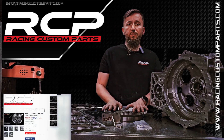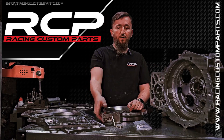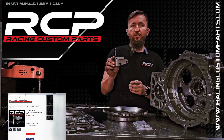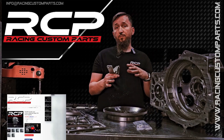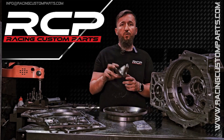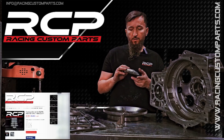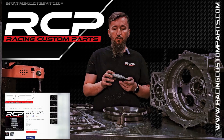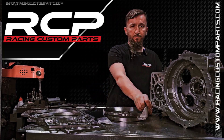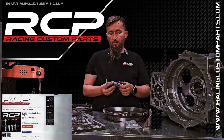That's why we developed the stage 3 and stage 4 flywheels, so they can be used in motorsports. With the DQ500 and MQ500 gearbox adapter set for the R32 engine, it's worth getting a mount for the transfer case. If you don't have our reinforcement or don't want to order it, you can order such an adapter from us as well — it will hold the transfer case on the R32 engine. And since the transmission is disassembled anyway and you're probably reprogramming it, we also have aluminum mechatronic sleeves with O-rings — brand new. You can replace them during the whole modification. So: mounting, transfer adapter, mechatronic sleeves, and an adapter for the shift cable from the DQ250 gearbox.